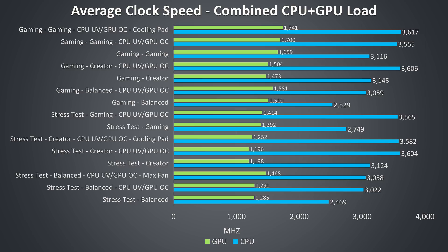These are the average clock speeds for the same tests. There was a 500MHz all-core increase with the balanced profile once applying the minus 0.14v undervolt to the CPU. This doesn't really change if we max out the fan, as thermals are not the limitation. The creator profile gives higher CPU clock speeds compared with the gaming profile at stock, as expected, while the GPU clock speeds from the gaming profile are higher than creator mode, again as expected based on what these modes do.